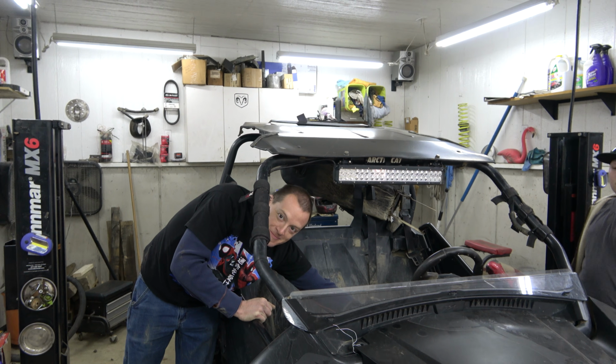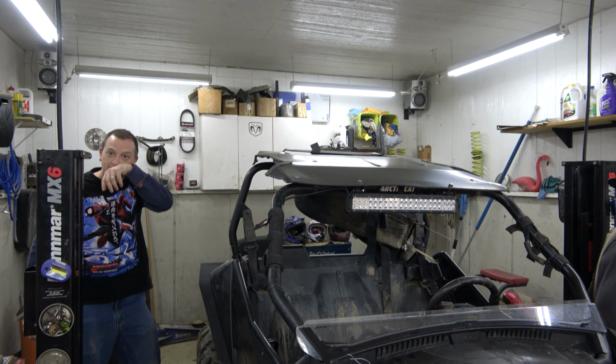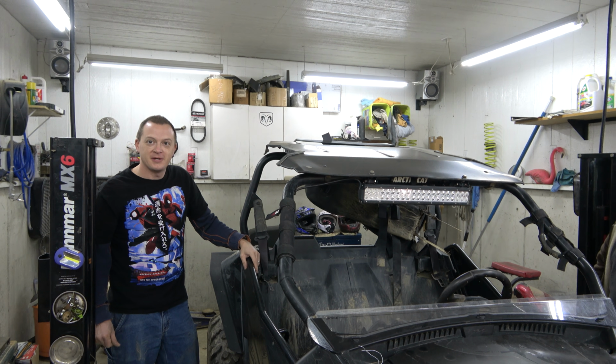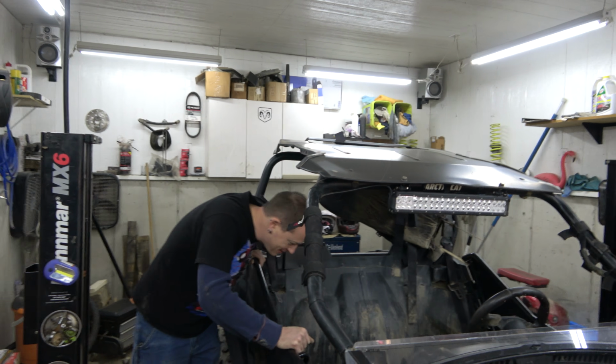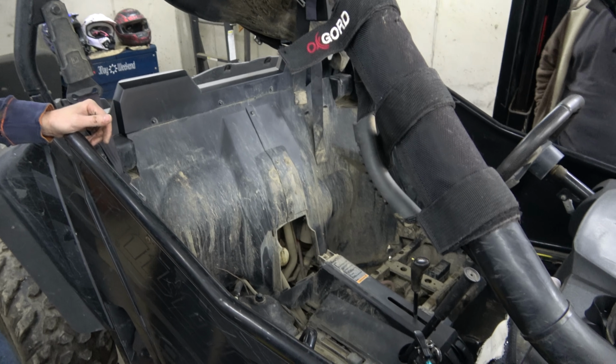That was it. It was running on one cylinder this morning, the whole way down. The other one never fired. It was covered in gasoline, the spark plug. Spitting and sputtering. It's crazy. Spark plug went bad. I was worried it would be coil or something, you know? Right. Alright. That would have been bad. So it just needs a service.